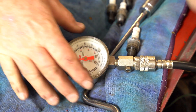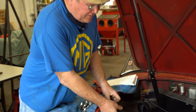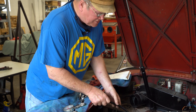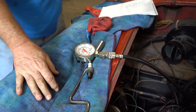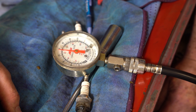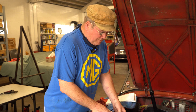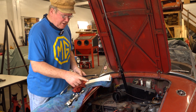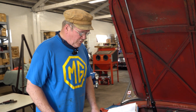And look at that. We're looking at inlet valve, exhaust valve, piston rings. The other ones have got a buildup of carbon in them, and this one doesn't. You don't know. One, two, three, four, five, six, seven, eight, nine, ten — 145. So we are within our spec, barely. Of course I didn't write them down, so I don't remember, but I think it was 155, 160, 140. We're not in spec — those are 20 pounds apart — and then 145 at the back.